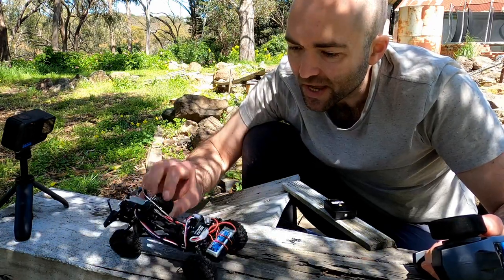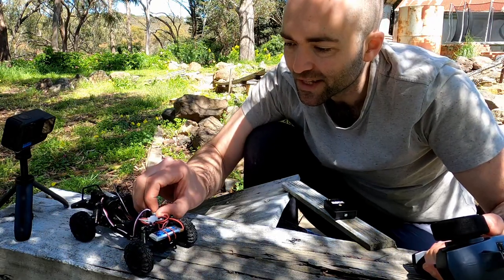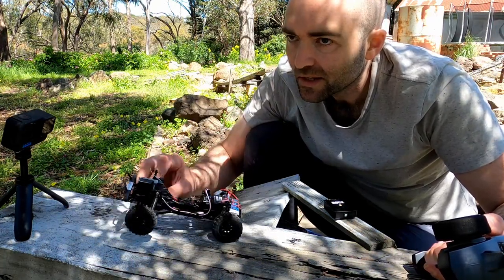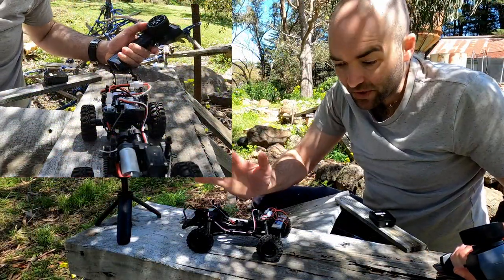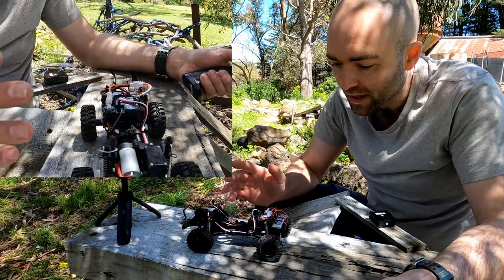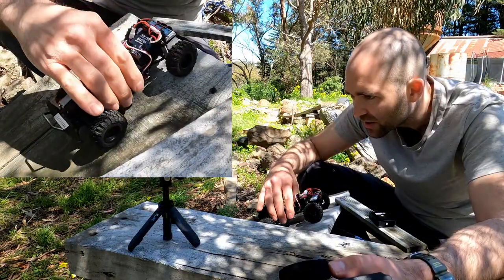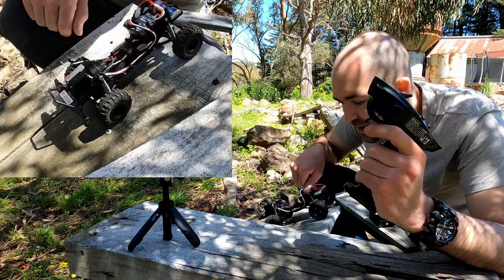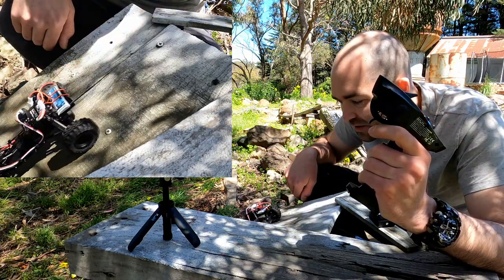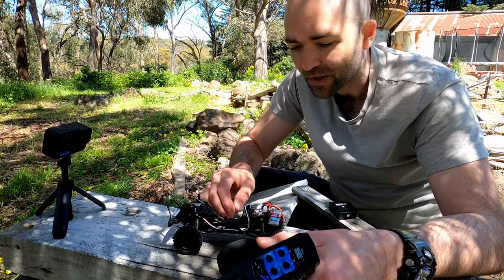Drag brake is evident. And we'll turn it off and see the difference. Yeah, there's real drag brake there. It's about a 50% rate, but that's all it needs to be to hold it completely. Like on a bigger truck, that'd feel like 100%. When I was going down descents, I found putting it on a hill like this and just holding the throttle gently, it would just kind of glide down the way I would like it to go. It was very controlled. So that's quite a big plus.